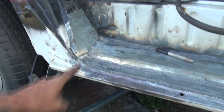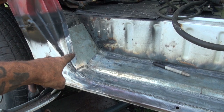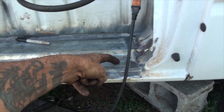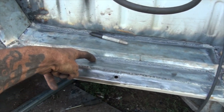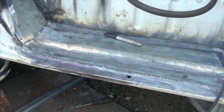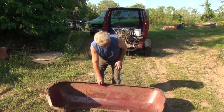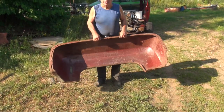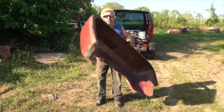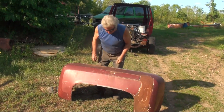There's nothing really left to do except massage that piece into a curved piece and weld it in place, and then grab a three quarter inch strip and weld it down here to hold the rubber seal in place. And that's it. Anyhow, the battery's almost dead too. What did you find? It's a perfectly good fender for my step side. Nice. Right on. Look at you buying stuff — my God. That's hilarious.